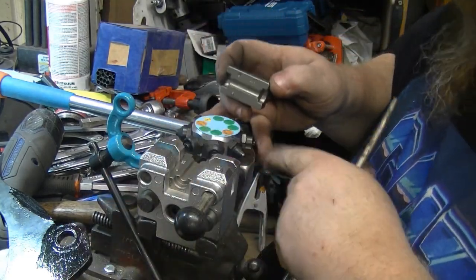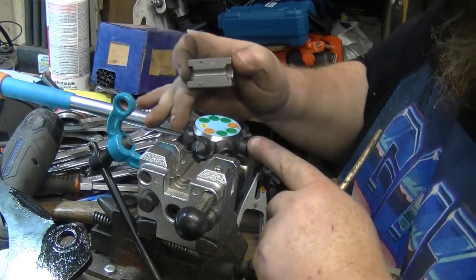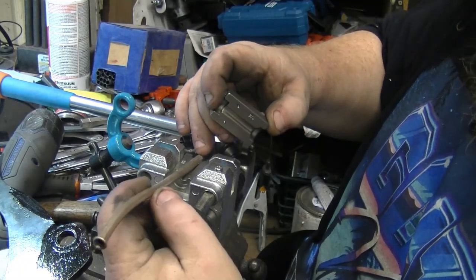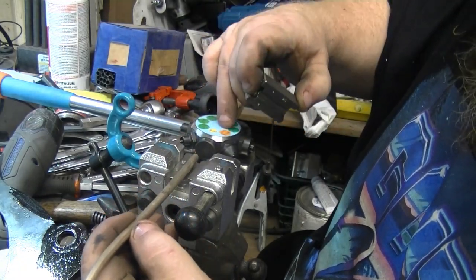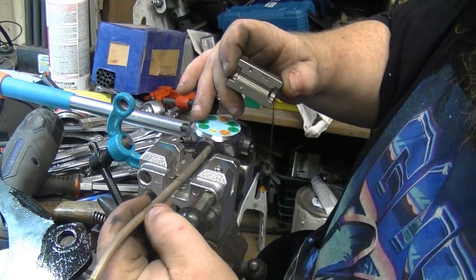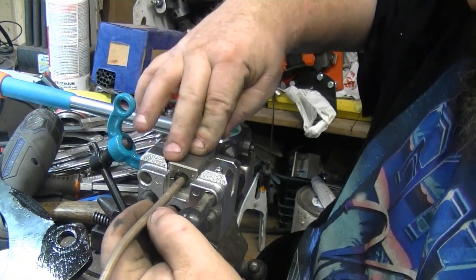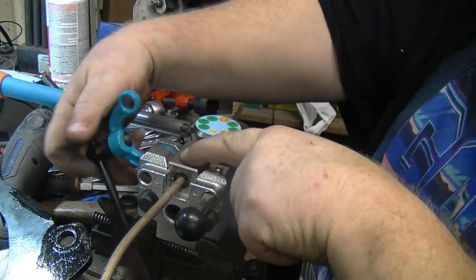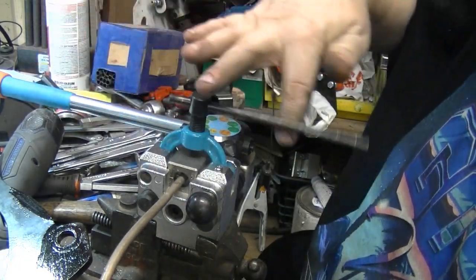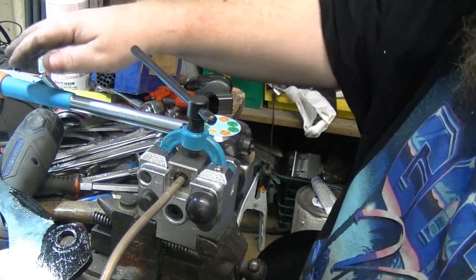So, put your line in. First, this thing has a lever, and a rotating head with all your dies. You literally just put your line in, turn yourself to the operation 0, the flat face die, put your line in up to the die, put your other die on, flip that, push that through, run this down just a little bit just to hold the dies.